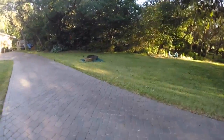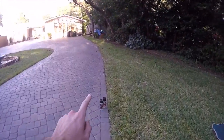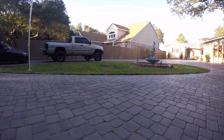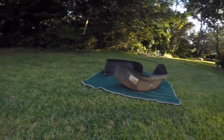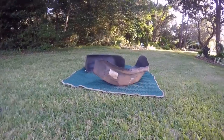But like I said, I already got the driver's side off. So I'm about to hit these with some soap and water, clean these up. And I'm going to be using the same stuff as the bumper, or what I use on the front bumper, that Duplicolor trim and bumper paint. It works pretty good on the bumper, and so I'm going to try it on the fender wells. I've never put it on the fender wells before, so this will be the first set I've ever painted, and we'll see how it goes. So just learn from my mistakes. If it sucks, it sucks. If it's good, it's good.